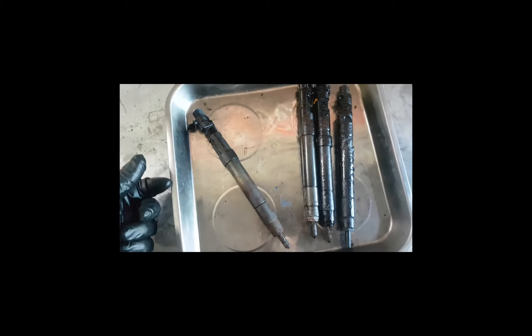But something interesting - I'm doing one at the moment as a preventative measure. These are out of a Mercedes Sprinter that we've got. This is a good injector, so it had no blow-by, but you can see just how much the washer erodes away. We're not getting too far away from it eroding and turning into this situation, so pre-emptively we're doing this one, getting some new washers on there before it happens.